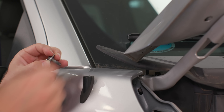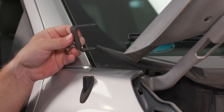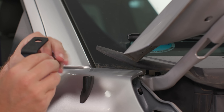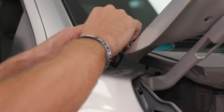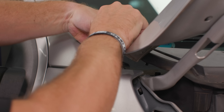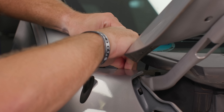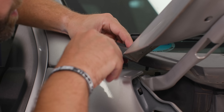Now we're going to take our bracket. Make sure it's aligned with the C facing the inside of the truck and you've got your tall bracket here on the top. You'll notice this angle coming back towards the rear of the truck, so it's going to drop that bolt right back into place. We're going to put it under this black plastic tab here and into the truck's frame. Now let's grab our socket wrench and tighten it back down.